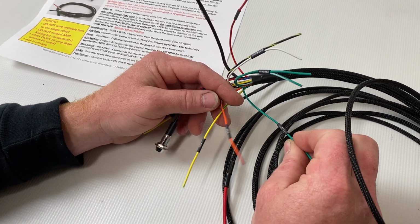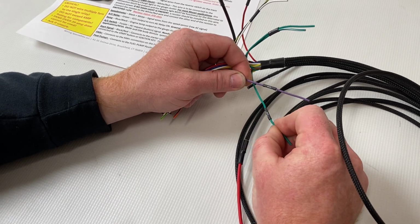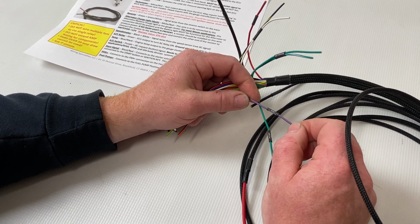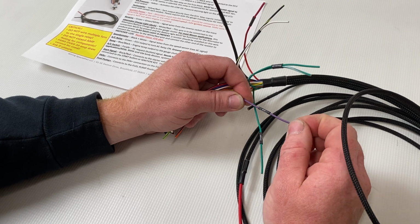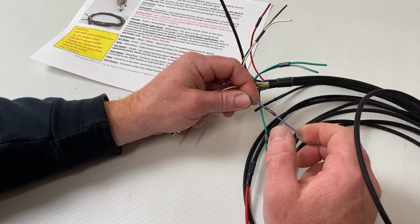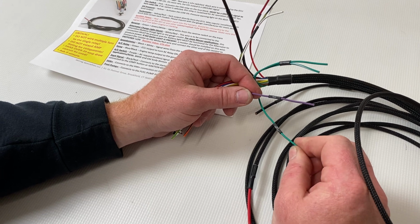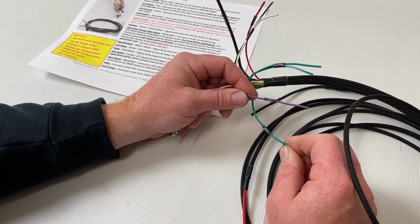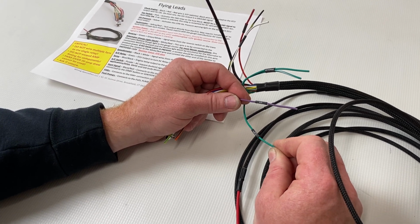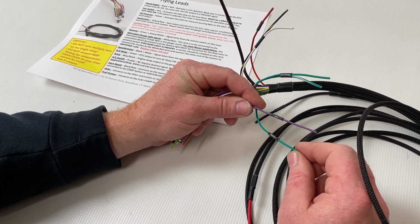We've got AC relay and AC switch. So these ones are a little bit more in depth. Depends on what type of ECU you're running, but on most of the JDM applications, AC switch will be a ground input which will go to the ECU. The ECU will then allow permission, which is going to go out to your AC relay. Now you have to keep in mind that the AC system, the relay has to have a secondary safety. So it's going to have to go through pressure switches. That way you can't overpressurize the system and potentially damage or explode the AC compressor.